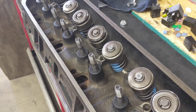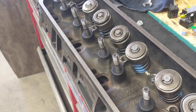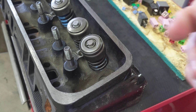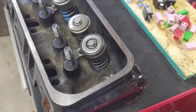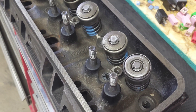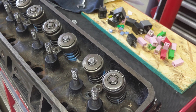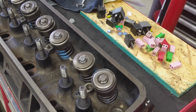After talking to the machine shop, they pretty much don't install the umbrella style anymore. What they do is take a cutter, kind of like a hole saw — with the spring, retainer, and keepers out and the valve gone, just the guide left — it basically machines the outside, turns down the outside of the guide. It uses the guide as a guide, keeping it straight as it runs down the bore, and machines them down to 530 thousandths.